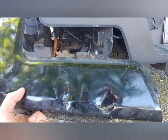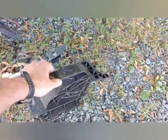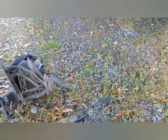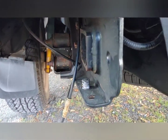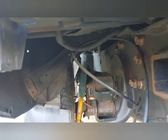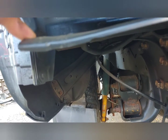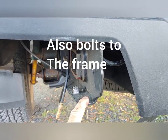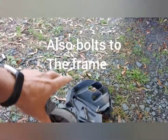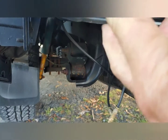This is trashed. That could maybe be straightened out, but I've ordered a new one. The piece underneath was completely destroyed. So basically, this is your bumper — it is plastic. Underneath here there's a very thin little piece of sheet metal that this attaches to, and I mean, that's it. The frame's right there, the plastic was one piece, attaches here and bolts under this flimsy piece of sheet metal.